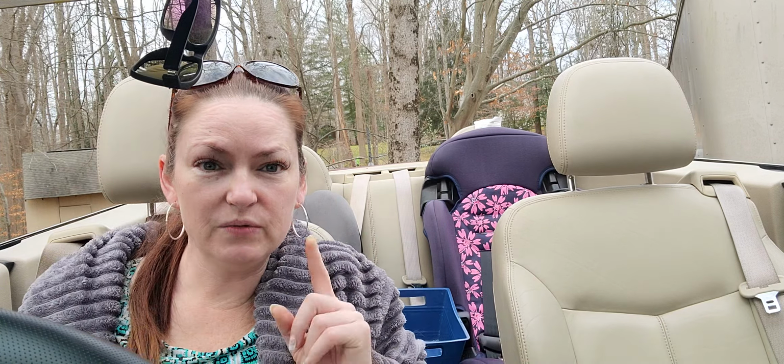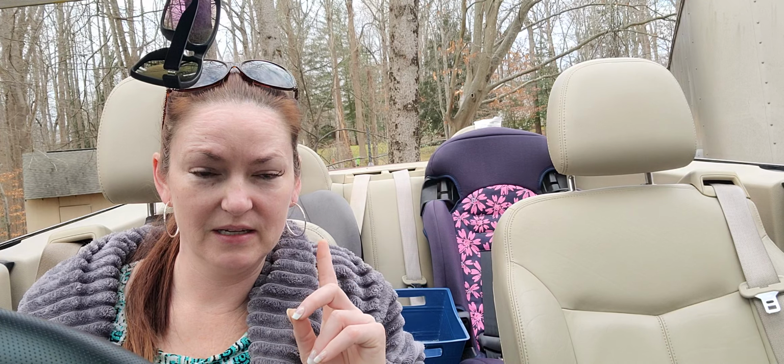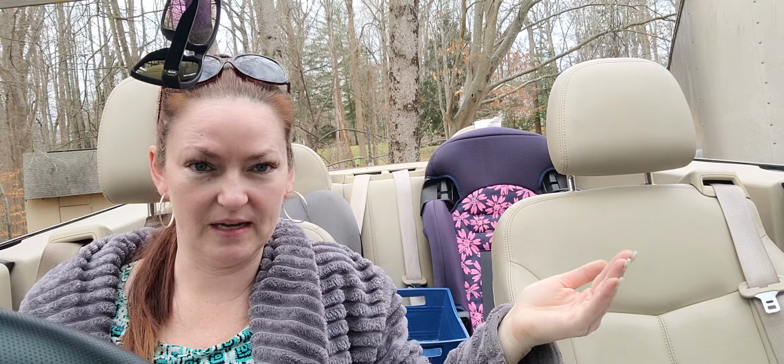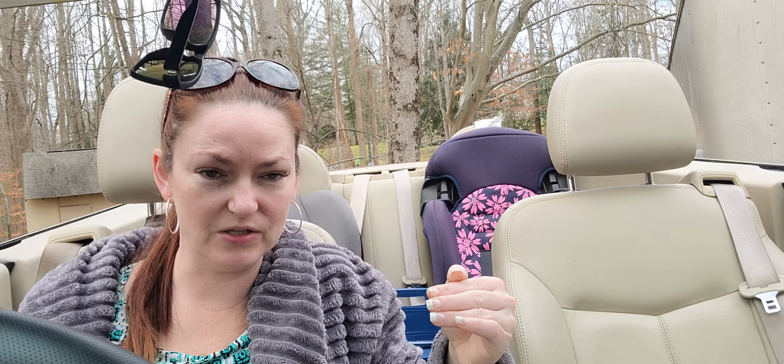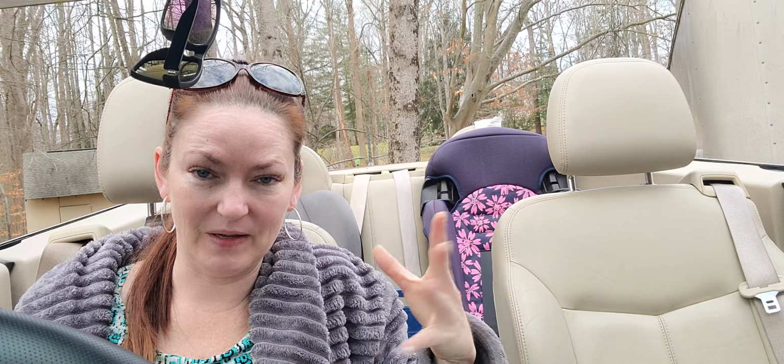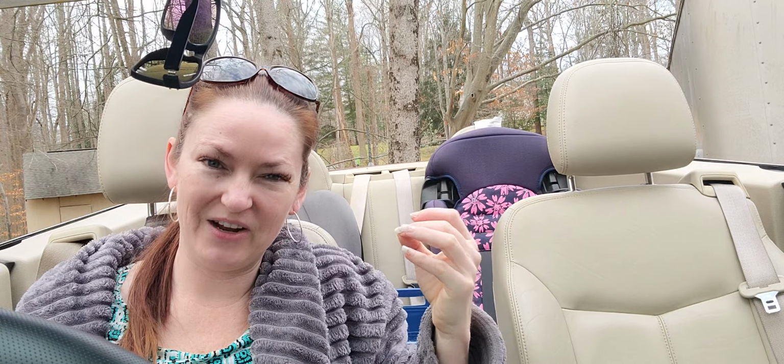I'm going to stop it for a second. There was also a spring click coming from that side. You hear that? This would be best if you had a second person to do this, and then you say, okay, stop, and then you listen, and then you fix the problem. Typically, I'm solo, so clearly I can't do that. So I'm going to listen while I put it in going up mode, and then I'm going to stop it, and then I'm going to start spraying parts, because I hear very distinct rubbing. I hear very distinct clicking of a spring or stretching of a spring, and then I heard a little pop.